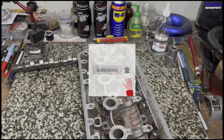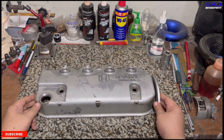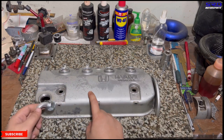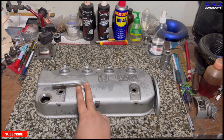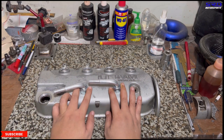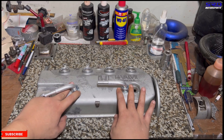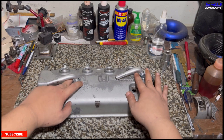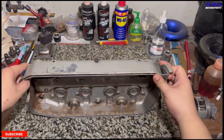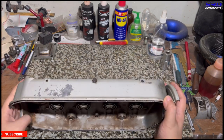Here is the D16 A6 or D15 B7 valve cover. We're going to put the breather up top here because we can't put it on the front floor — the baffle is only at the top. We'll put one here and another here. We can put it a bit wider but putting it on top might start hitting the hood for clearance, so we're sticking with the positions shown.